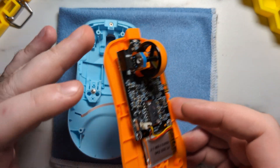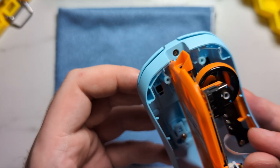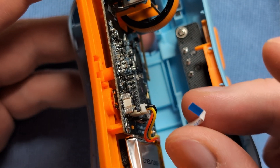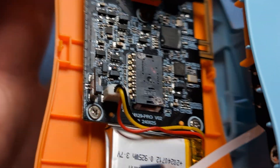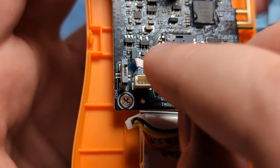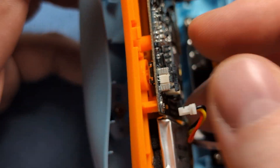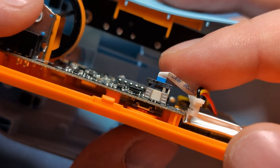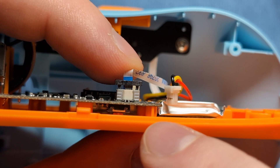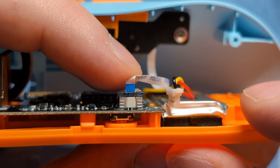Next we can reconnect the top shell to the base. Grab the ribbon cable and gently pull it off to the side, then put the shells into each other roughly and sandwich them together. Pull up the black connector, then take the side button ribbon cable with the blue facing outward and put it onto the inner side of the connector. The battery cable may make this a little tricky, so I'd recommend disconnecting it and putting it off to the side. Gently thread the cable into the connector — this can be a little tricky due to the angle. Once it's roughly in, gently push on the top to push it down. Make sure the blue piece is even with the PCB, as if it's off to the side your side buttons may malfunction.